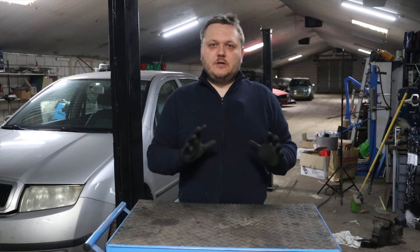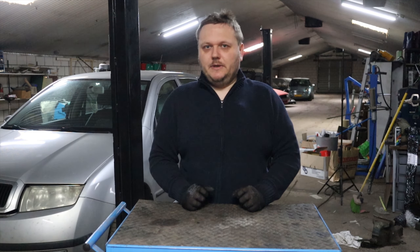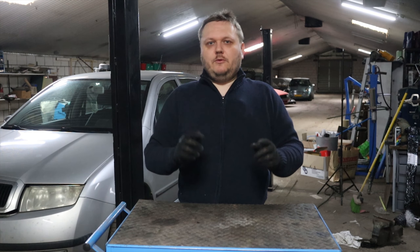The first thing I thought was maybe the alternator was seizing up, or had some bearings in there that were not 100%, because squealing and power loss most of the time has something to do with that. The water pump could also be an issue. She brought it here, and that squealing I heard was definitely not from the multi-belt — I double-checked it, removed the multi-belt, and the squealing was still there.